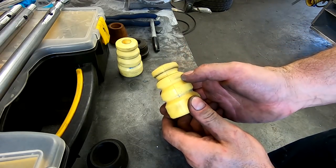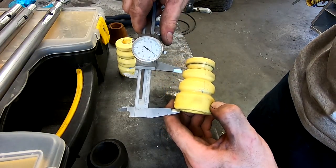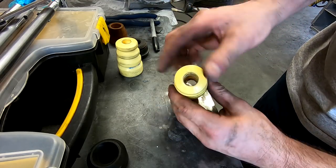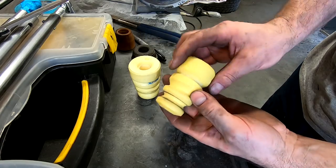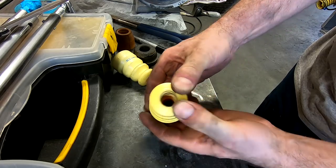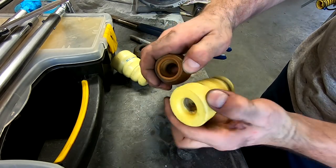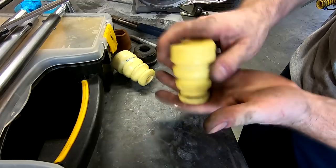We want right around a two inch tall bump stop, maybe two and an eighth — 2.125 inches brings us to about the middle of this ridge. We're just going to lop off the soft small bit and run them like that. One last thing to note: these are the hardest durometer on the scale. This soft one I can squeeze really easy; this hard one I can barely move. That should help out too.